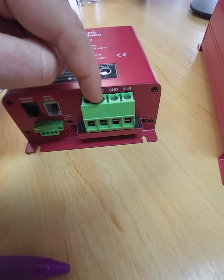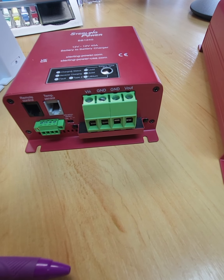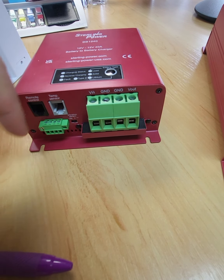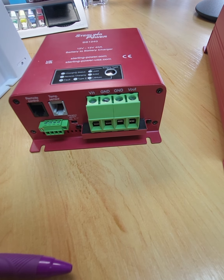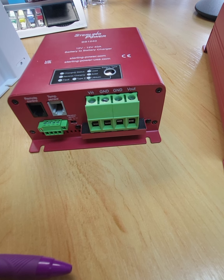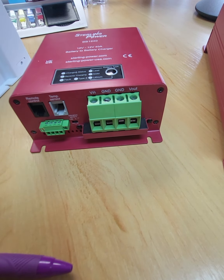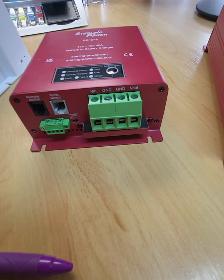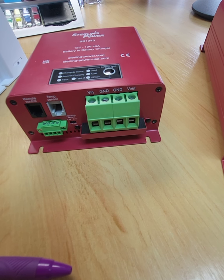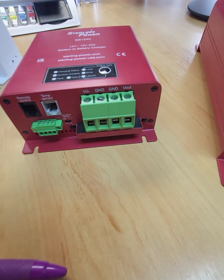In terms of normal connection: voltage in, voltage out, and then common negative. You can wire both the input negative here and then the output negative out to the leisure battery. Or you can just common up the starter battery to the leisure battery and feed a thinner cable just to one of these connectors, because all the current through here is just the differential current — the difference between input and output current. So you can wire it up either way.